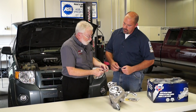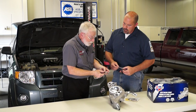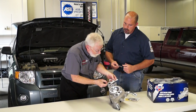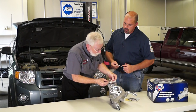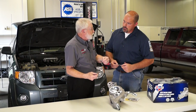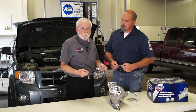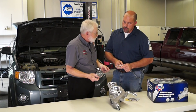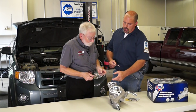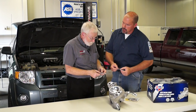This older type gasket is metal, and you would think metal handles a lot of temperature — but this thing actually fell apart. We see a lot of water pump jobs that aren't replacing the water pump; they're replacing the gasket because the gasket failed. The water pump was still okay. You'll have a leak between where the water pump bolts up to the engine and the water pump itself, especially on those designed with silicone embedded into the metal.